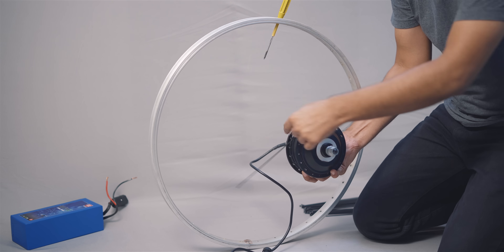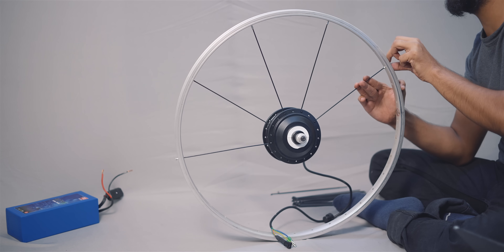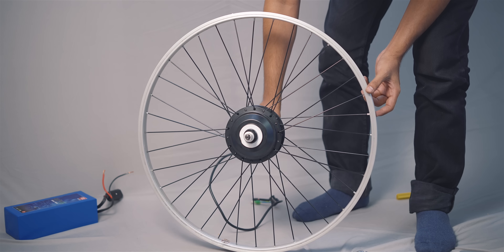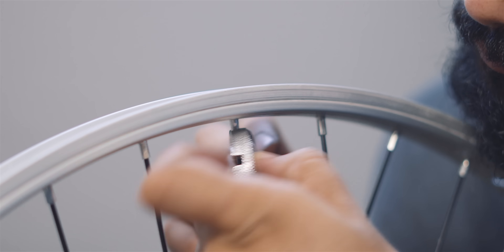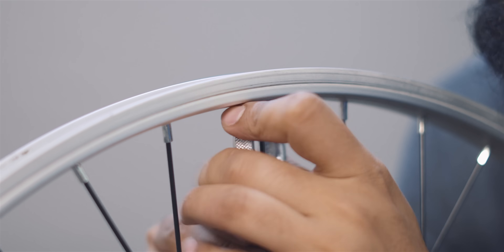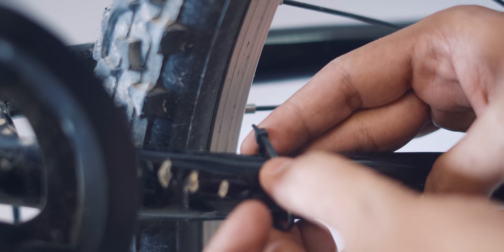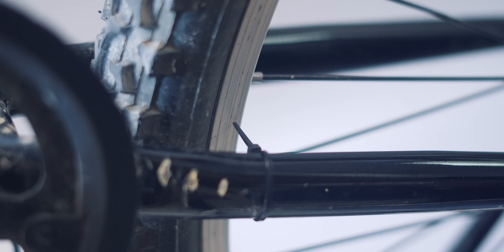It's time to reinvent the wheel — just kidding. We're simply going to replace the existing hub with the hub motor and the spokes provided with it to create a new wheel. The weaved pattern is what gives the wheel its strength and keeps it lightweight. After tightening the spokes as precisely as I could, the wheel showed a slight wobble, which I thought wasn't a big deal — but I was wrong. I had to re-adjust the spoke tension. The technique I used was tying a zip tie with its end pointing towards the rim, giving me an approximate idea of the axis, and then tightening the spokes accordingly until the wobble was significantly reduced.